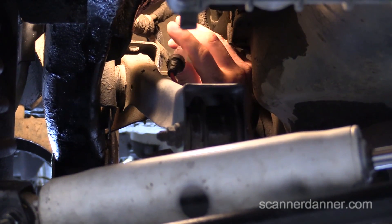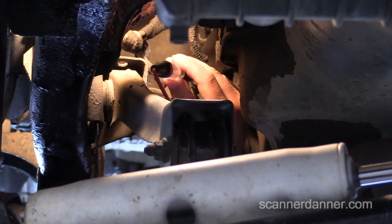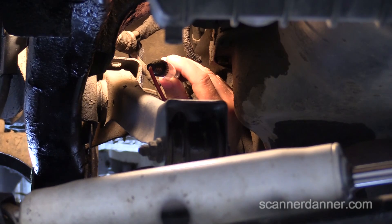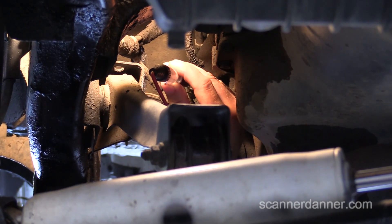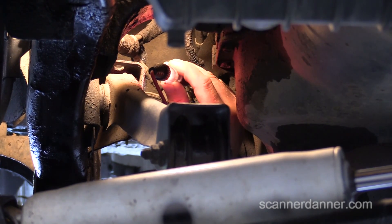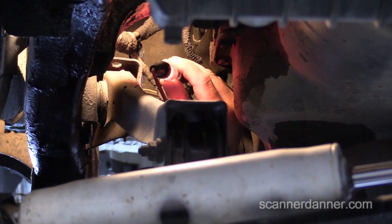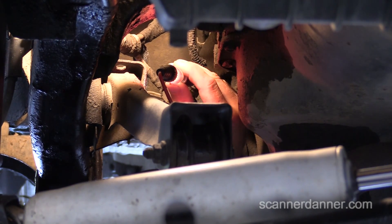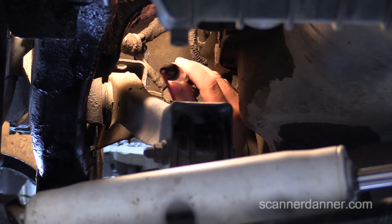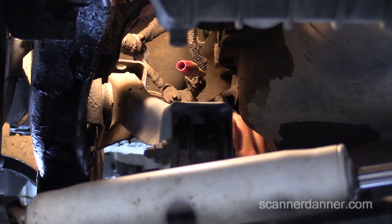The next one is the smaller gauge wire — I'm going to my piercing tool connection. Go ahead and turn it to the crank position. Notice the light is lighting. That means everything inside that part you bought for the ignition switch — the circuit — you don't need it. We have power here. We have power in both locations where we need it. One last test with the test light would be the starter housing itself, checking the ground on the starter, again done with a loaded circuit.